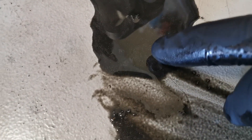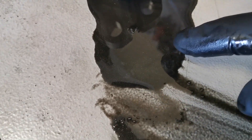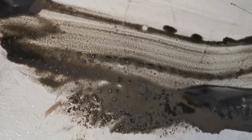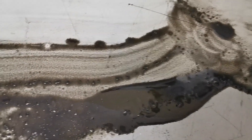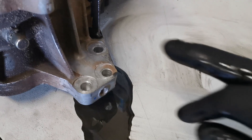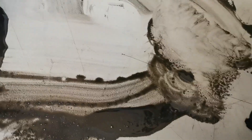I'll bring you over to this side where the oil came out. This should not be anywhere like this color. You can see the metal shavings that are all in there — those little sparkly bits with a metallic coloring. That is the result of transfer case oil that has probably never ever been changed.